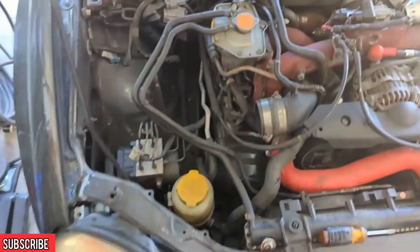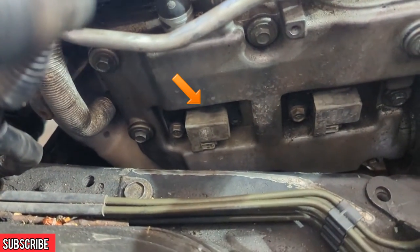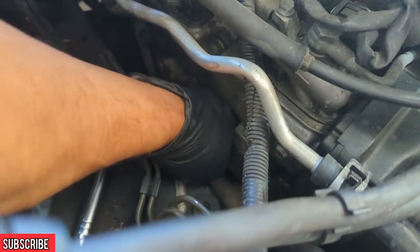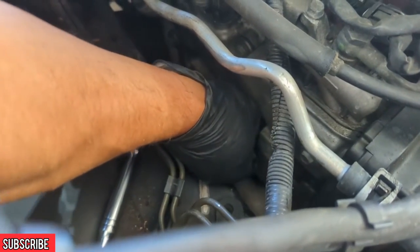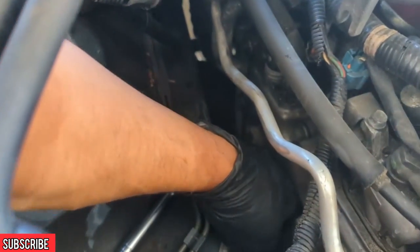And now, while we let the oil drain, we're going to move on to the next step, which is changing the spark plugs. Those are going to be right down there behind the coil packs. That's the fun part here, because it's a boxer motor, so we don't have a whole lot of room. Out back, yeah, because that's usually pretty warm down there. Here, I'll hand you the coil pack after I'm done. You can tell me how warm it is. Oh, great.